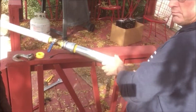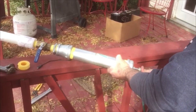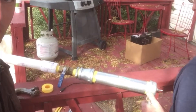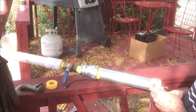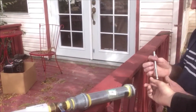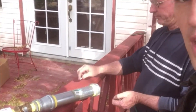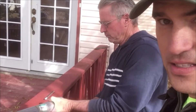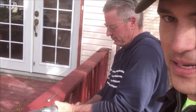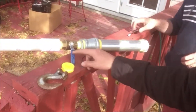We just use a compressor and a piece of air hose. You can see Mike airing it up now. The chamber isn't that big so it doesn't take long. Then we use a tire gauge to check it. Once you've checked it, you do have to put a little more air in because checking it lets out around 30 PSI. Then you've got it ready with the valve closed — no leaks.